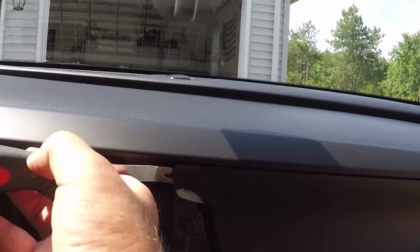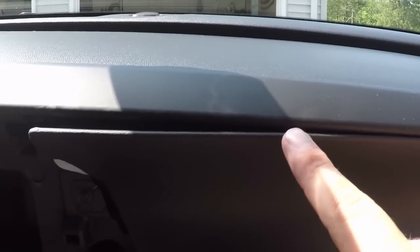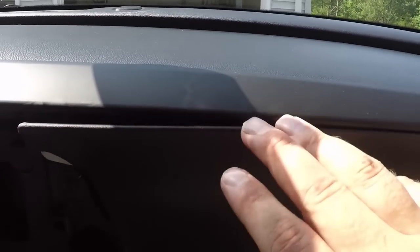That one is out. Now we're gonna stick our interior tool ever so carefully and get this thing started. I kind of stick the interior tool on the inside so we're not really prying against the dash or going to damage the vinyl. Just be careful, work from the inside, and work the clips out one at a time — you'll get it out nice and easy.